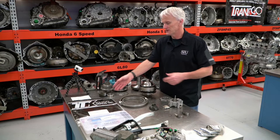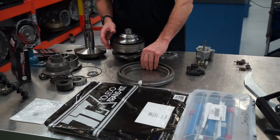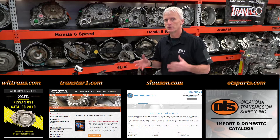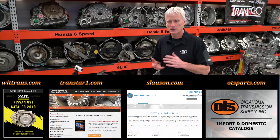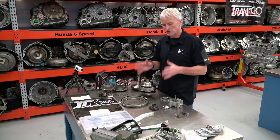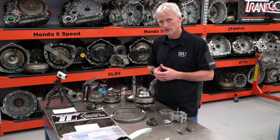Other issues were the seal kits. The seal kit manufacturers have stepped up and provided seal kits, and there are actually some improvements that they've done. And even things like new belts — you can buy them now. A lot of people will still reuse a belt if it's not bad, or they'll source a used belt. A lot of parts suppliers are carrying used or good quality parts; they purchase up cores, disassemble them, and sell pulley sets, belts, valve bodies — that kind of stuff. That allows you different options. If you take this transmission apart and there's a lot of damage, you can actually get decent used parts and build these things back up. And the aftermarket has stepped up with components that improve upon the original design, so hopefully the failures won't repeat.